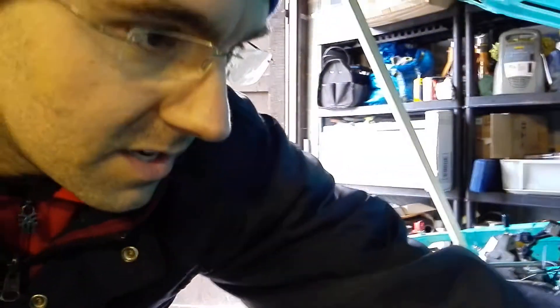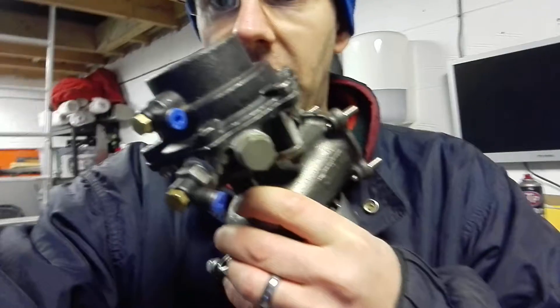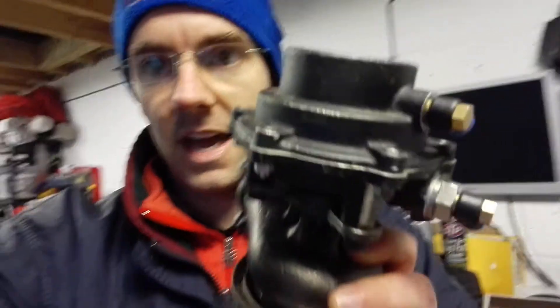Wiring wise, I've done various bits and bobs. I've got my MAC valve in so my boost control solenoid is here and sorted - that's all wired in, I just need to work out how to mount that. I also gave the wastegate a service and sorted out various different plumbing bits for it. I've got push fit fittings on there now which are all tapped in and sealed.